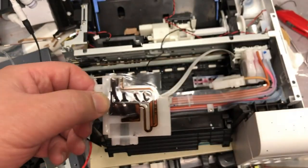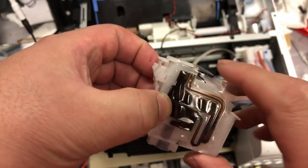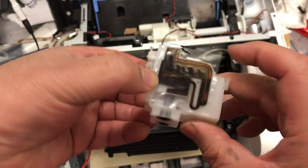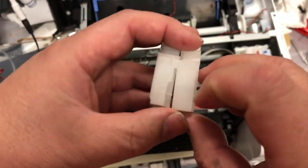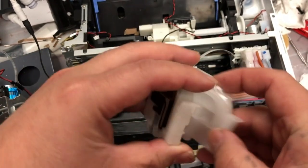Are they interchangeable? Dampers are interchangeable as long as you don't mix up positive and negative. These two positive dampers — you can see their shape is a little bit different. The half moon one has a tab on the top. The square one has a longer ink channel, and on the back, the square one has a notch. I'll show you how to modify the half moon ones so you can fit them in the square slot.